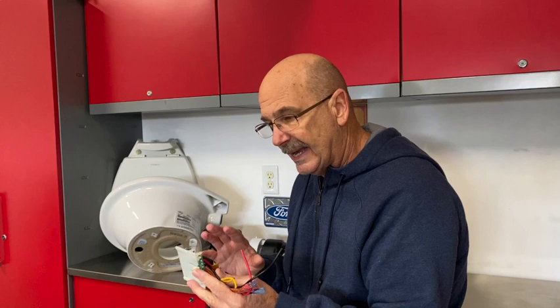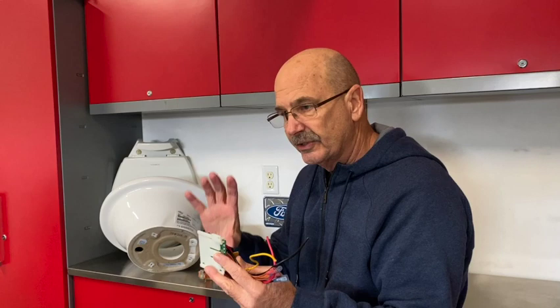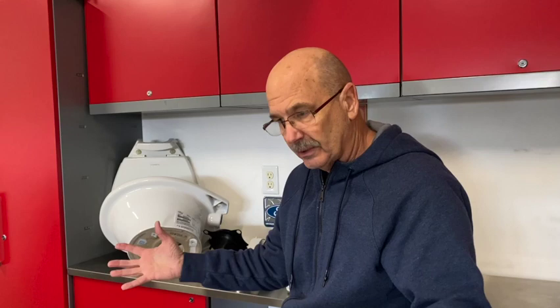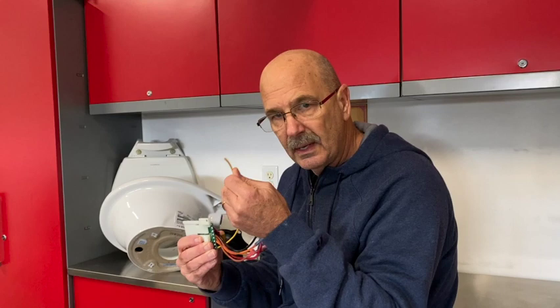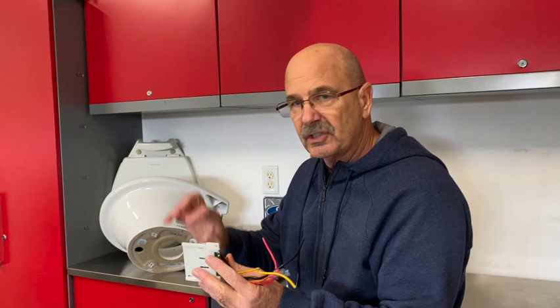The float level sensor and the Precision Circuits tank panel need to be reset every once in a while. The sonic sensors mounted on the outside of the black and gray tanks — those stuck-on, non-through-tank-probe type sensors — are historically inaccurate. However, those sensors have nothing to do with the yellow wire. The yellow wire gets its signal directly from inside the black tank through a float sensor that slides up and down.